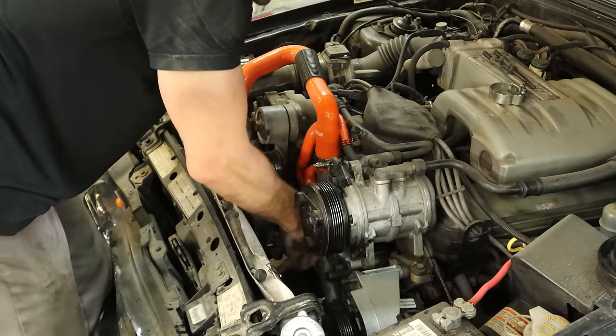We got the hood off and now since it's up on the lift we'll take a look at the bottom. It's not super clean but it's also not bad at all — some surface rust, nothing a little sandblasting wouldn't take care of. There's no holes anywhere. We're not building a show car so we're not going to worry about it. Up here straps rust out, floors rot out. This one looks like it might have seen a winter or two, but definitely did not get driven year round. The torque boxes are nice and solid — they usually like to rot out pretty bad. The worst spot on the whole car is right there and it's just flaking off a little bit.